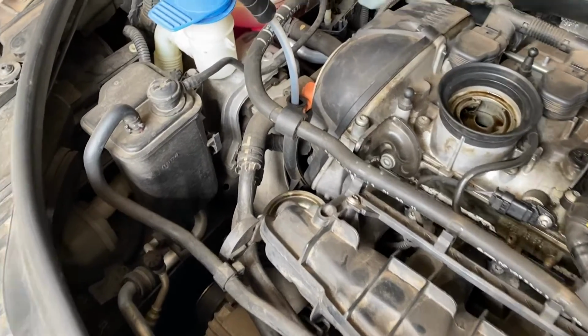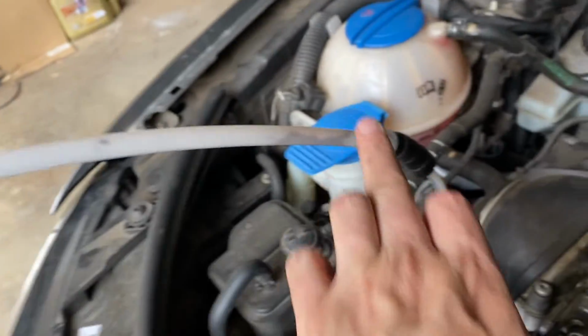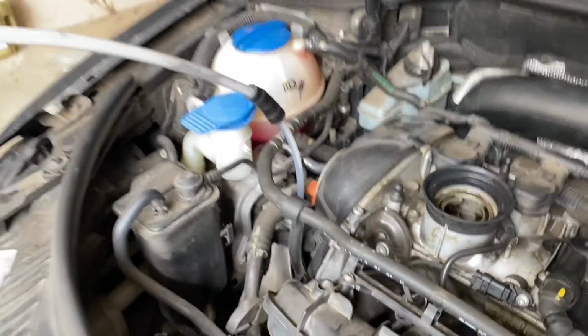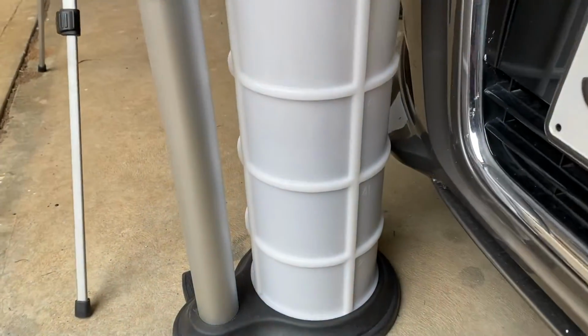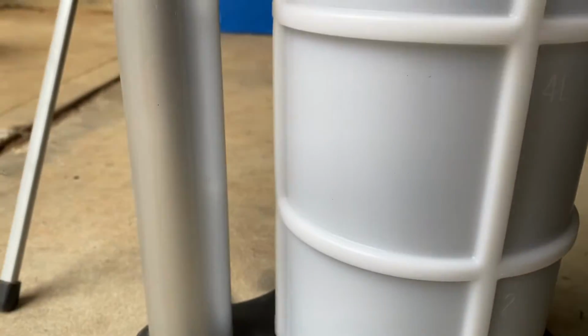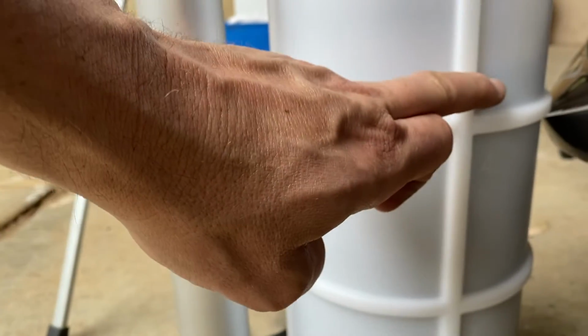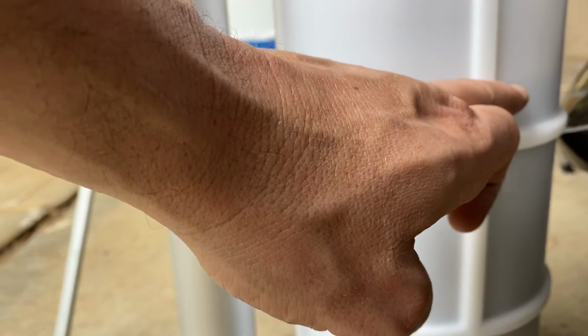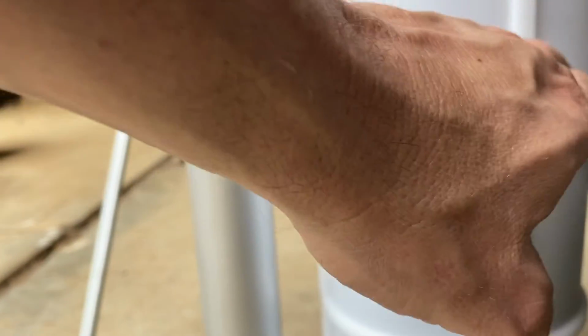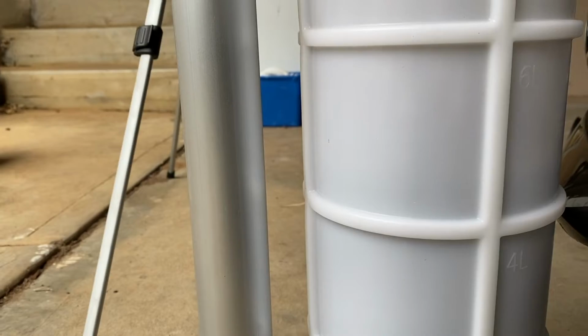All right, so you can see now the tube has gone clear on the extraction. Got the oil filter off, so it's clearly drained all of the oil out of the engine. If we just have a look, it's pretty hard to see. We've got markings, we can see we've got a 2, 4, 6, and the line is just about here. So this engine actually holds 4.5 litres. So you can see it is pretty much just over 4.5 litres that we've extracted.